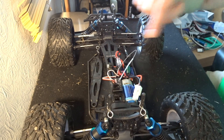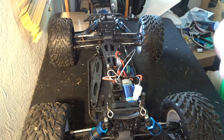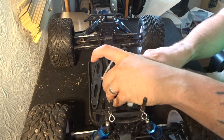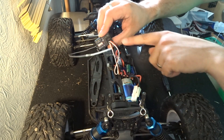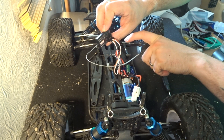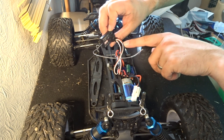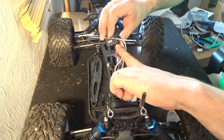What we're going to do is take off this bit and add the receiver that came with the Flysky itself. I'm just going to use a little screwdriver here and just pop that off. Now, because you've got dual feeds here — one going off to the ESC and one going off to the servo at the front — you're going to want to keep an eye on which one is top and which one is bottom, which one's connected to channel one and which to channel two.